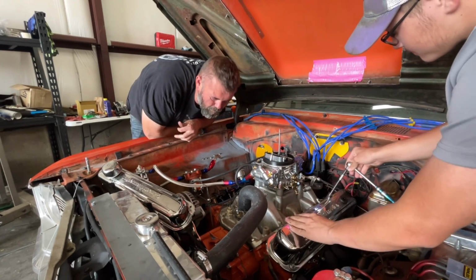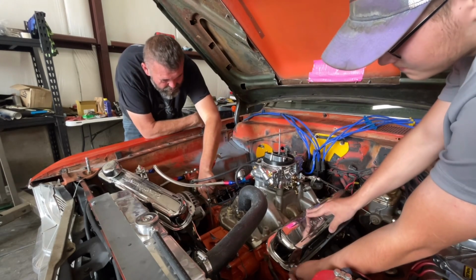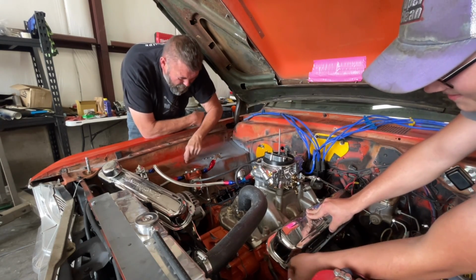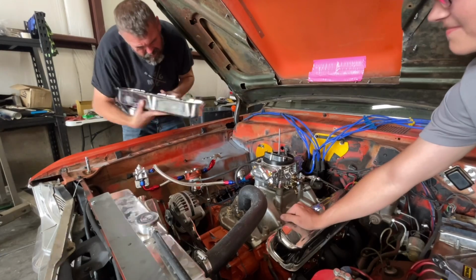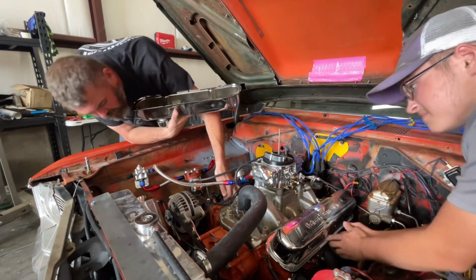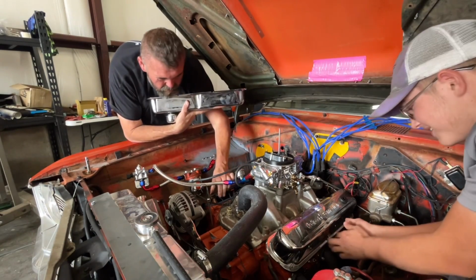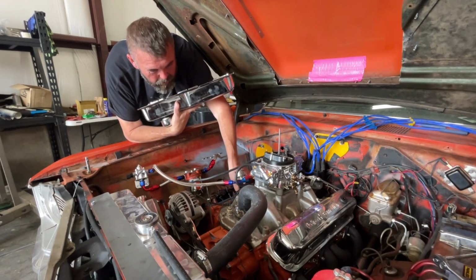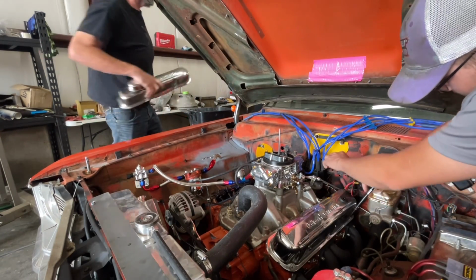Well, I see a problem on this side, which is probably still going to require at least the, oh, nope, I got lucky. Look at that. One of the nuts came off of one of the rockers. I wonder why it's so discolored though. Oh, that rod is definitely bent like crazy. So it probably got really hot right there. That might be the issue, or probably is the issue.